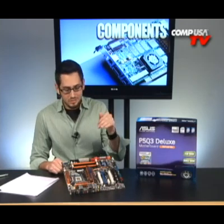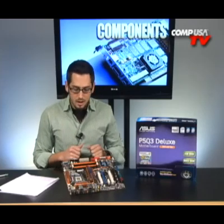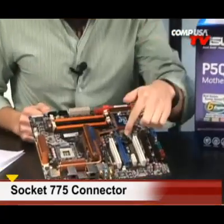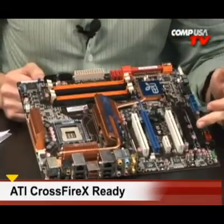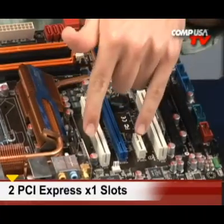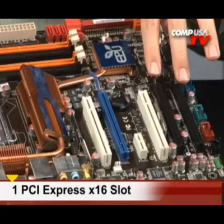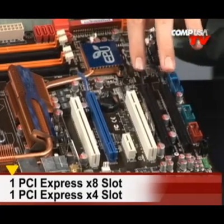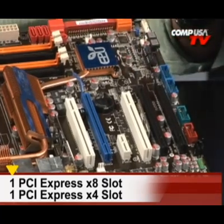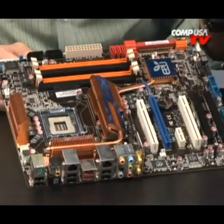Now that we've gone over the P45, let's actually get into this board. If you just look at it, it is a gorgeous looking board. Socket 775 here, and we do have CrossFireX support with multiple lanes. You have two regular PCI slots, two PCI Express x1s, the 16-lane PCI Express 2.0, and then eight and four-lane PCI Express 2.0 and PCI 1.0 respectively. Up to 1600 megahertz front side bus on your socket.